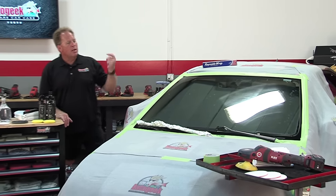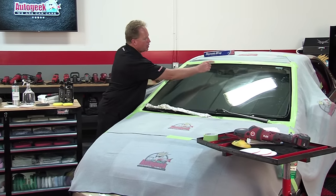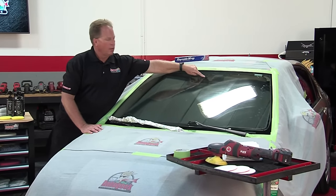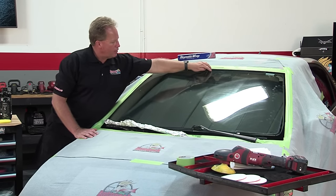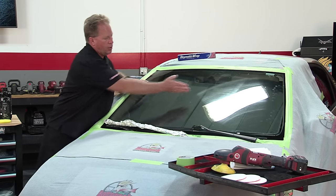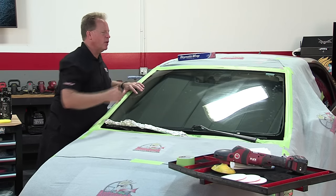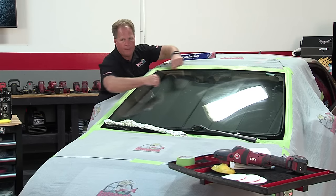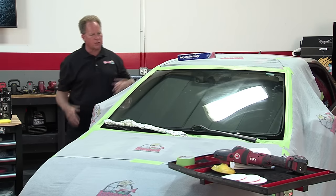Okay. But anyway, so when I go to polish out a windshield, what I'm going to do is I want to divide this up into four quadrants. Usually, I will locate the mirror here, okay? And that's center of the windshield. And then you think of a straight line down there, and then you can either divide it up, here's a section and here's a section, or you can crosshatch it. So here's a section, and of course do the same thing. And then you're going to spend solid buffing time, about 30 minutes minimum, on just one quadrant. So you divide this up into four sections, 30 minutes.